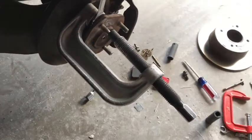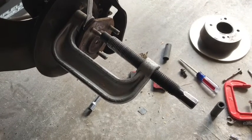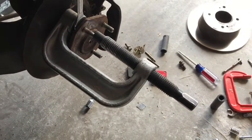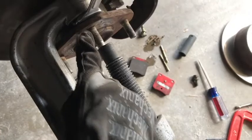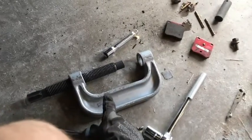Here's my setup. This is the closest thing you're going to get to a hydraulic press, which is what they would use at a mechanic shop. Pep Boys said it would cost $250 to do this, which is ridiculous because this little part only costs a dollar and that's the only thing that's wrong. We're going to do it for free with a couple of tools lying around anyone's shop. The wrench wasn't working as a spacer so I used a piece of steel and a piece of acrylic that I cut some holes in to get a perfect spacer in there, then put this around it and pop that stud out.